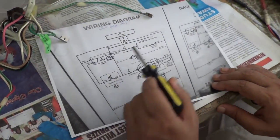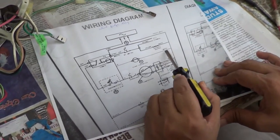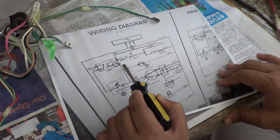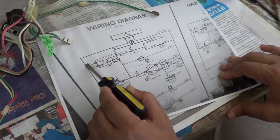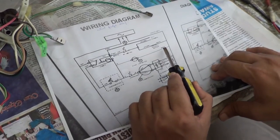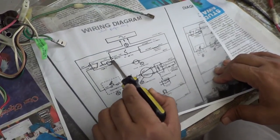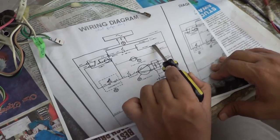This is the wiring diagram of the Whirlpool refrigerator we are dealing with. Here on the circuit diagram you can see the fan motor — it comes directly from the AC supply and goes to the timer switch, where the timer switches it on and off and makes the circuit on that pink wire. What we've noticed is that the fan motor switches on and off, so more than likely the problem is not with the timer.